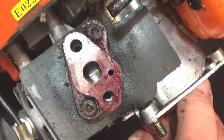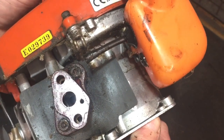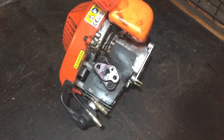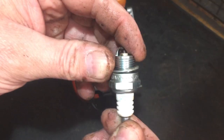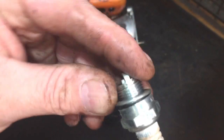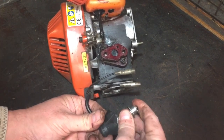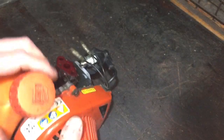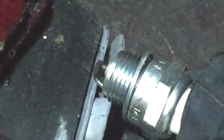There's no problem in there — it's all good. So we know the actual internals of the engine are going to be okay. I'm pretty confident. Good compression as well. The next thing I'm going to do is check for spark, so I'll take the spark plug out. You just saw me take that out — it's a brand new spark plug, hardly done any work at all, so that will be going back in. But we need to see if it's got spark first. Yep, we've got no problem there — it's got spark. So it's all looking pretty good on this machine.